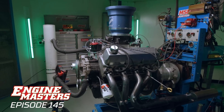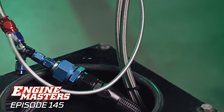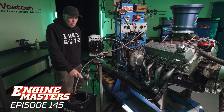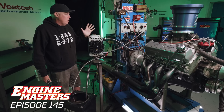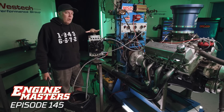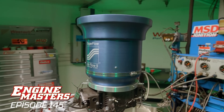Here's how this whole thing is going to work. Our idea is to mimic the conditions of a fuel system in the car as closely as we can. Step number one is this nitrous bottle heater, filled with water with a heating element in it, and we've got about 10 feet of fuel line running through it. We're going to heat the water and measure the temperature of the fuel with this thermocouple. On the first test, I'm going to block off the airflow through this cooler to get a good baseline, and of course we've got the dyno telling us the horsepower.